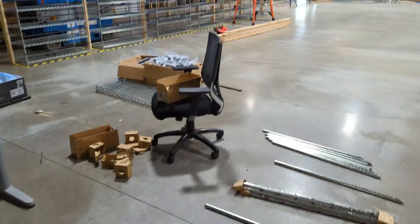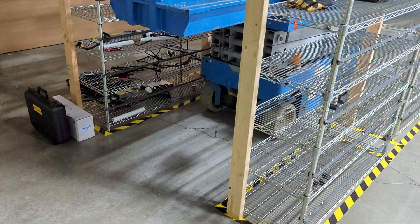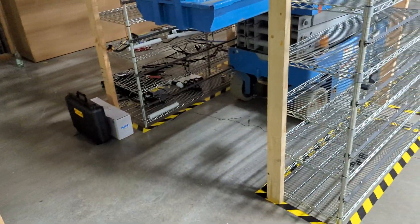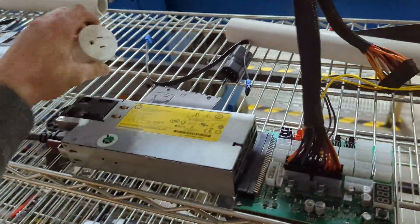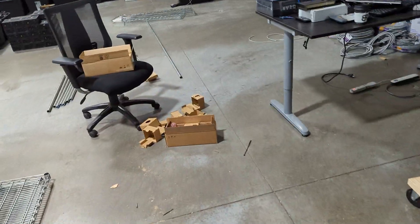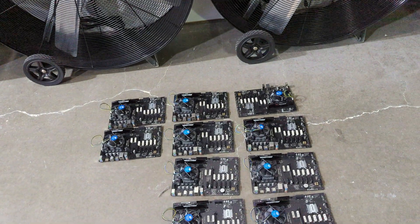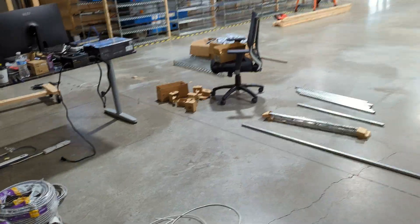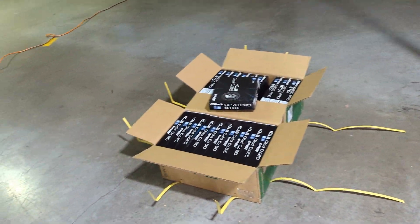After all that, to make sure it actually works — once we start setting up the board — we do that to all 30 boards. After we do that, we plug in the board for that first rig and test it for Tekken. Tekken is the wireless on-and-off power cycle — we plug it in, plug it into power, then kill the power, wait about 10 seconds, and turn Tekken on. If the auto power-on function of the motherboard is working, it should turn the board back on. Once Tekken checks out fine, the motherboard has saved all the information we gave it and it's ready to be deployed. After that, we start building out the rig — put on the GPUs, the risers, plugging everything in and getting everything ready.